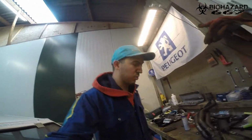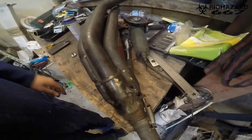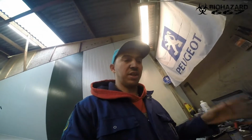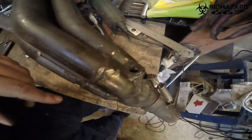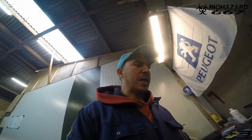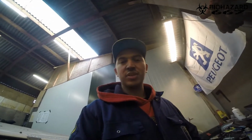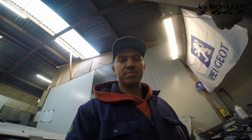Okay, well, this is only the second clip and I already had one hell of a wrestle. It took me hours to get the old lambda out, because when I bought it, it had an old lambda in there and it was so unbelievably stuck. It took me, I don't know, 2.5 hours to get that thing out. I eventually ended up drilling it out, and it did go pretty good. But the threads did get a little bit damaged and I don't have a tap for it, so it has to be tapped right now, so I can't continue today. I have to make some phone calls probably, and we'll continue after that is fixed.